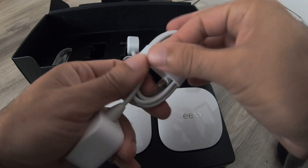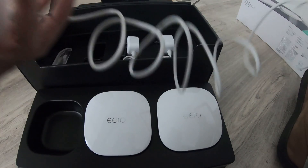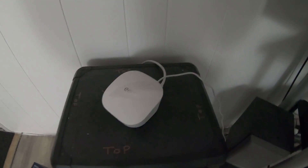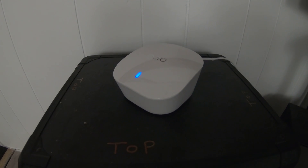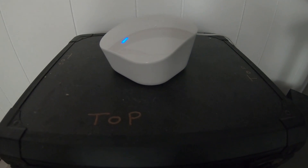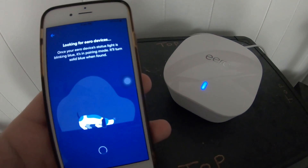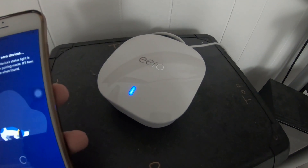Here's our first AC adapter. I noticed the Eero devices use USB-C. So now we've got our power plugged in and our Ethernet plugged in. It says power up the Eero device first, then the modem — I've done as asked. I plugged in the Eero device, then the modem. Now the Eero device is blinking blue. Turn on Bluetooth. It's now looking for Eero devices — it says it turns solid blue when found, and it is solid blue. My device has been found.